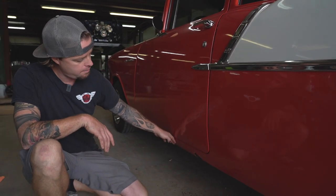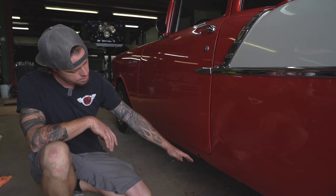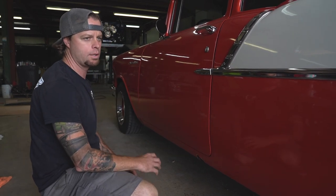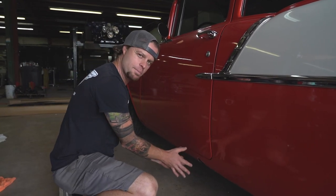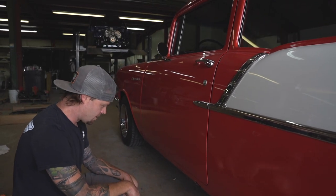What we're going to do hopefully next week — and we'll show you some of this — we're going to grind all of this out, get all of this metal repaired back to good metal, rust treat anything that needs it, and go as deep as we need to. We'll blend back into the quarter and hopefully make it like new again so he'll be good to go for a while. We're hoping this is just something they missed when they restored the car.